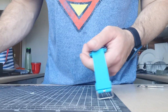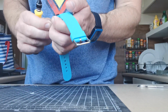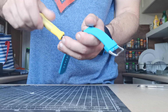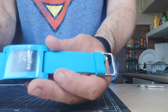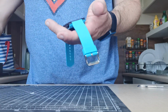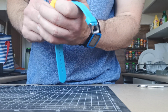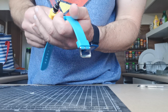Right, where are those other screws? I've never come across this problem before with the zebra strip not touching its connectors, so I maybe stretched the case a little bit too much. Oh, here we go. She's on. I think maybe I stretched the case when I pushed the battery in and that just took everything out of alignment for a second. So it looks like it's on, and even if this happens again, at least I know what it is and I can fix it pretty easily.